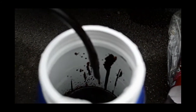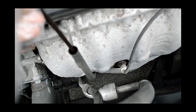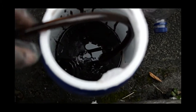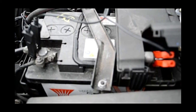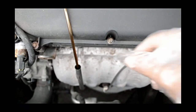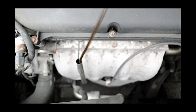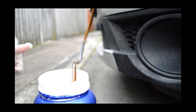You can see that nothing comes out now — it's just like a bubble, just air. Make sure you wiggle it a bit to make sure everything is extracted. Of course you may leave about 100 millilitres. Turn off and then start disconnecting from the negative and then positive. Make sure you clean the extractor by adding some clean oil inside before you store it. The whole process takes about 10 minutes.